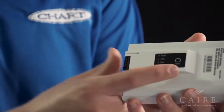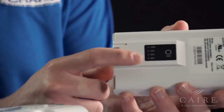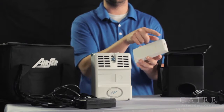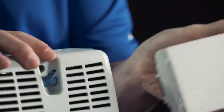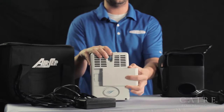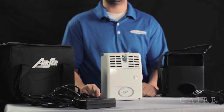Each Freestyle is going to come with a battery pack that you'll install inside of the unit to run for portability. If you look on the back of the battery pack, there is a test button that you can press to see how fully charged the battery is. There are lights for 25% all the way up to 100% — a great feature so you can check that your batteries are charged before you head out. The side of the battery that has the finger hold and the release button needs to be on the outside, so the other side with the pin connections goes in first as you slide it in. Align the battery pack with the front of the case and then slide straight inward and push until you hear it click.